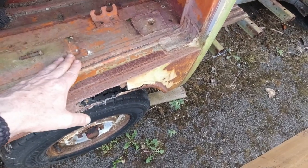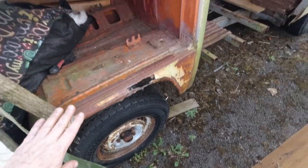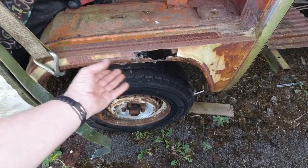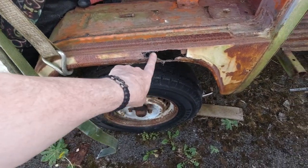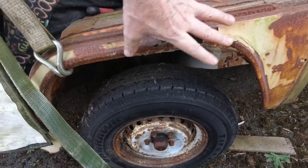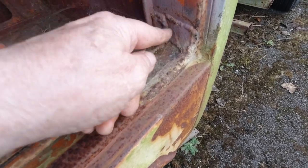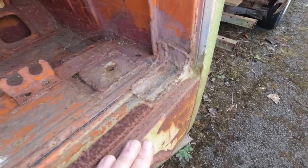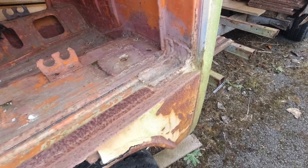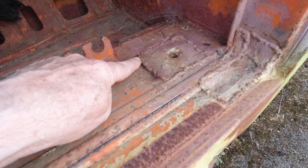Okay, guys, so here's another one of my buses, okay? And you see this area here? If it's a bay that you're looking for and you're after, here's where they're prone to rot out, okay? On this dog leg, it's called a dog leg, right? This area here is typical, this area from here to here, yeah? Again, you can see now what I'm talking about when I say about repairs. Look, there's a patch on top of a patch, and you can see it welded. It's strong, you know? It's not the worst. It looks terrible, obviously, because when you open the door, that's what you see, all right? Again, there's a similar kind of thing here. Guys, this is not my work, okay?